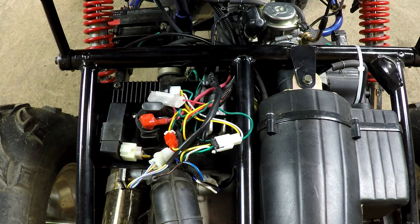After testing my stator, in my case I know the stator is good. If you have nothing coming out of the stator, it means your stator is bad. If you do have power coming from the stator but the battery is still at 12 volts when the engine is running, make sure everything is plugged in. That leaves two things: the ground wire — which is a common problem, so check your ground wire — and the next thing left will be the rectifier. This is all for when your machine is working. In some cases, you won't even have an engine running but you still want to test those two components, and I'll show that on the table in a few seconds.